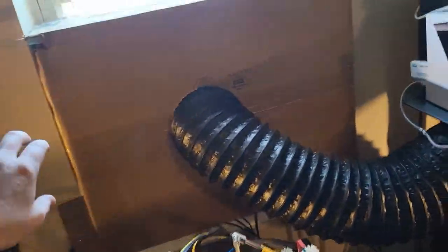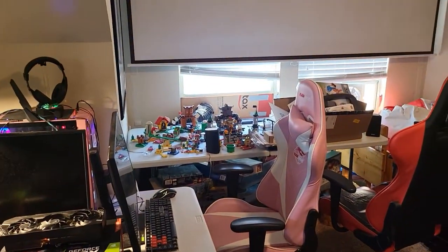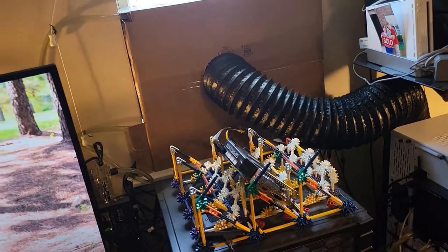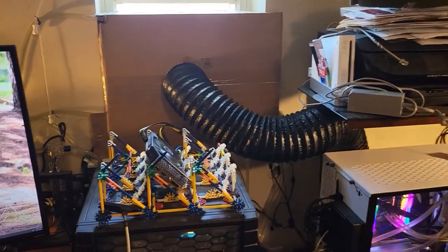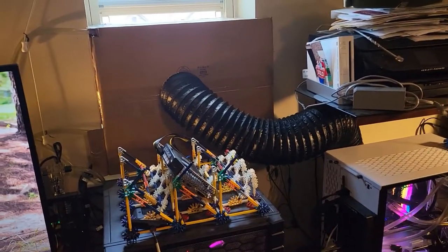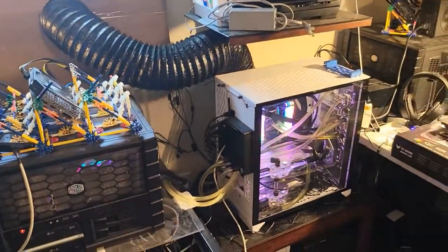So essentially it just fits in the window like that — cardboard, fairly cheap — so you can cut it like you want and fit it there. So we've got it pulling air in from outside, bringing it through and blowing through. Between all four of these 3090 cards, that's probably about 1300 watts of heat that's not even going into your room. You could probably do more depending on your window size. Really you just need two windows to do this — one to pull air in, one to blow it out — and you could cool a good bit of stuff without heating up your room.